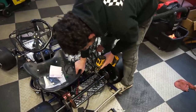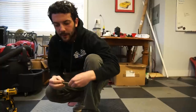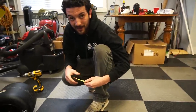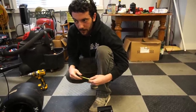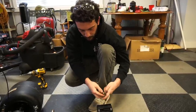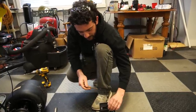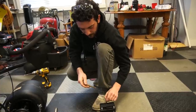I'm going to go ahead and do the wiring because I'd like to hear this thing fire up. We were getting ready to bolt our battery box into the diamond plate and realized we don't have a battery hold-down. We usually go with zip ties, but we're going to step it up with a proper hold-down: get a piece of flat bar, cut it to length, drill two holes, weld nuts on either side, then thread bolts into the flat bar into those nuts. That'll be our hold-down.